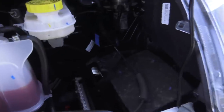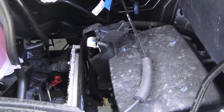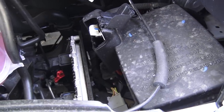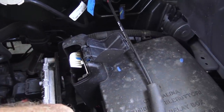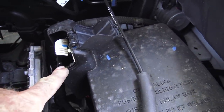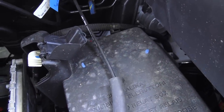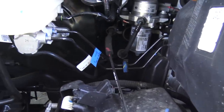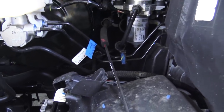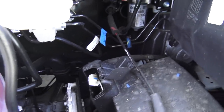The first thing that I look at is where we're going to install it, how we're going to ground it, and how we're going to pick up power. And right here, I've got a positive post that I can come off of for power. We need to put the solenoid in a place where it's grounded yet out of the way. We'll come up with some ideas for that. And then we're gonna figure out how we're gonna run the cable from the engine compartment back to where it goes in the coach battery area.